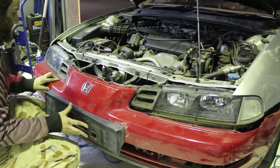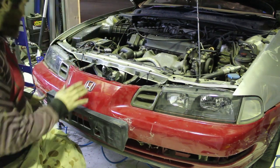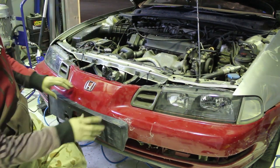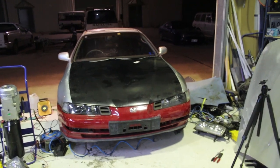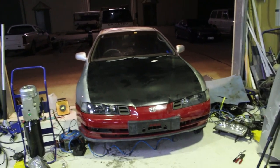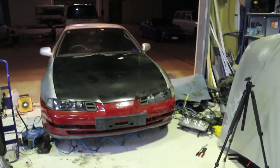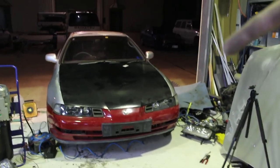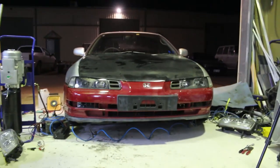The bumper has to be attached to the Rio and then the Rio goes on. Yep, that's on. It looks like such a different car now. The black headlights definitely look cool. The front lip looks cool, but the number plate holder just doesn't — I'm going to take that off and just put the number plate straight on the bumper. But it also just occurred to me, because I'm painting it, I'm going to take the lights and stuff out anyway. I'm going to take this all apart again, take the lights out, and then put the bumper back on. Normally you'd paint the bumper separately for a nice paint job, but because it's got to be two-tone and the tone goes around the bumper, I've got to paint it all together to make it easier to match the lines up. So now that I've seen it all together, it's coming apart again.